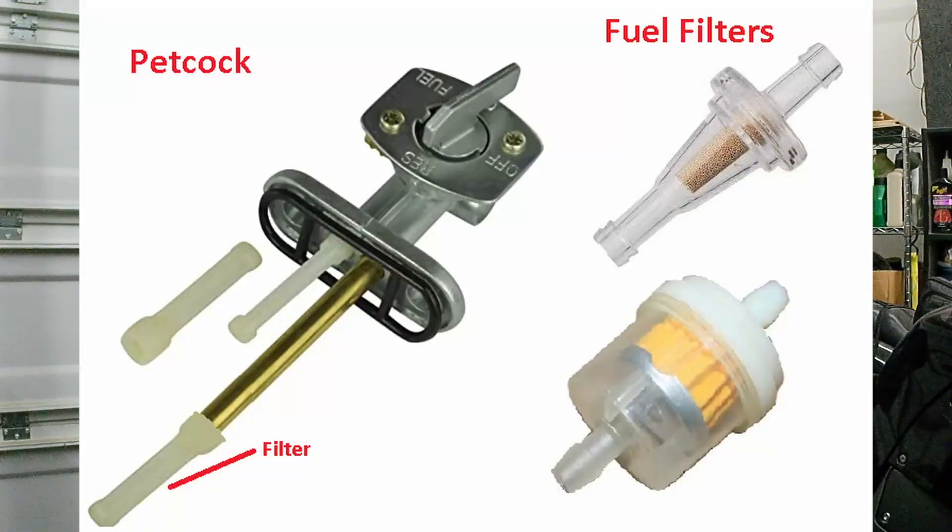Fuel — what to check: make sure the tank has a filter, usually a little screen on the inside. Make sure that's not clogged and it flows. I like using see-through tubing so that you can see the gas is actually flowing. If not the tubing, then use a see-through filter so you can see that the filter is getting gas in it.